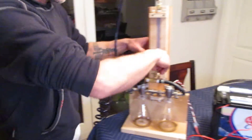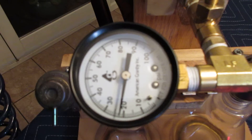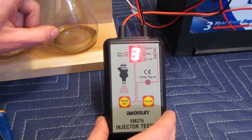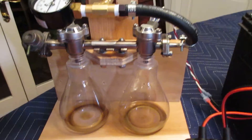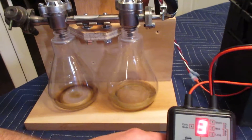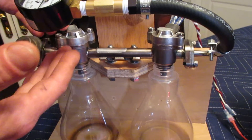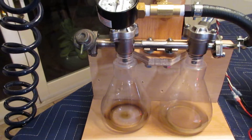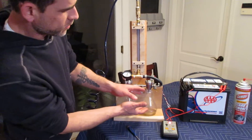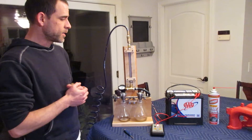All right, that's pretty close. Open up the needle valve. You can see at our gauge we're at just over 20 psi — that's good enough. Anything over 20 psi is pretty much operating pressure for the system when it's in the car. We now have our fuel injection tester connected to this injector. I'm going to hit pulse and we should see a mist coming out — that'll clean the injector. That's one pulse, second, third, fourth, and fifth. Five pulses done. Now I'd move the leads to the next injector and pulse it five times as well, comparing volumes to assess relative flow rates.